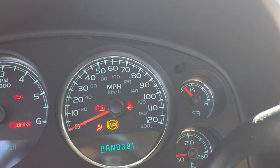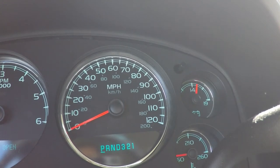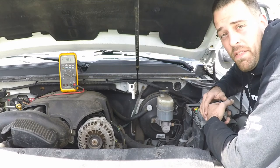It's staying down. And then all of a sudden it'll start jumping up and closing in on our 14 volts. In this case, we're going beyond 14 volts. Looks like we're about 14.8. Something like that. Similar to what we saw on the Saturn when it first started. But after the vehicle starts charging itself and it starts topping up that battery, this will begin to drop again, and it'll get closer to that 14 volts, a little bit more than 13.5. It wants to hover around there. So in this vehicle's circumstance, it's operating about 15 volts.